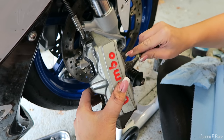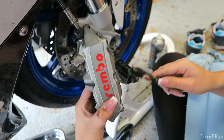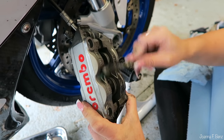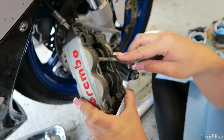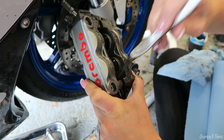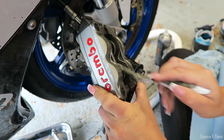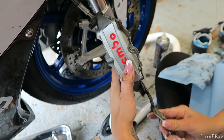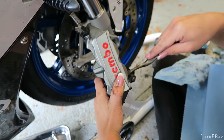It's silly little things that can actually make you go faster. If these pots aren't particularly clean and they're not returning into the caliper, it's going to drag on the front wheel, it's going to slow you down. I'm sure that's my problem. But you see people spending thousands of pounds on something that might make them go 3 mph faster. Well, if you lubed your chain, changed your oil and cleaned your calipers, which costs nothing, you'd achieve it. It's very satisfying to know it's all clean.